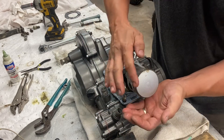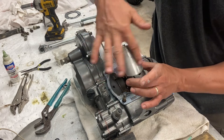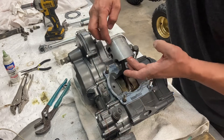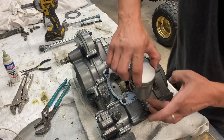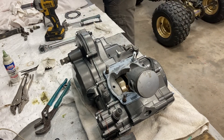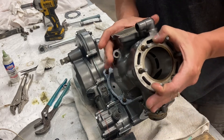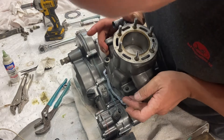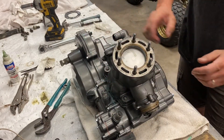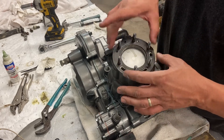At this point I'm going to take a little bit of oil, lube the rings, and get the piston skirt lubed a little. You don't want anything dry at start up, and oil is cheap and easy. So, line your piston rings with the correct markings and little notches. The cylinder is pre-lubed already. And that is it — we're going to go down, torque to spec, put the cylinder head gasket, torque that to spec, and this engine is a wrap.